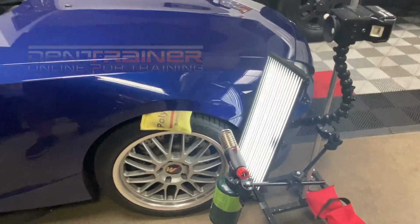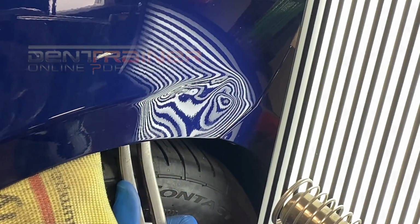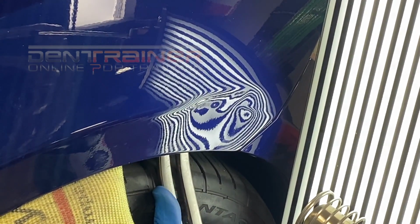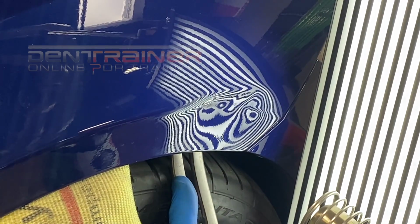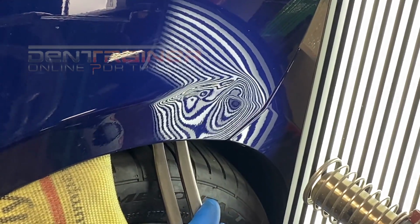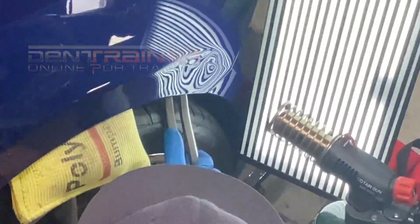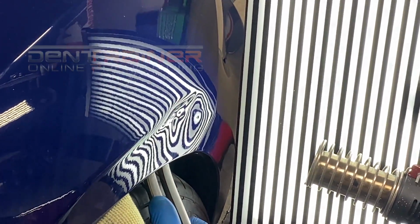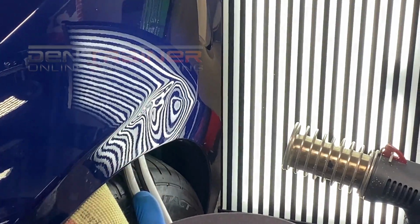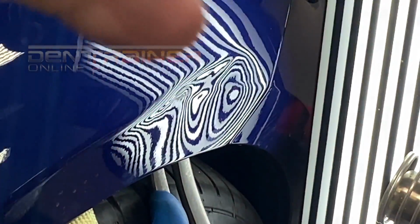Okay. We'll watch a little bit of John while we're here. He's using a pivot tip. See, nice. Look at how nice it wants to move. He's trying not to create more work for himself at the end, so nice smooth pushes, reading it. As you see, he's gathering the metal towards the deepest part, towards the front of the edge. And really what he's doing as well is taking the pressure off the top of the crown, which is right up there on the top.